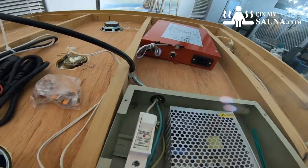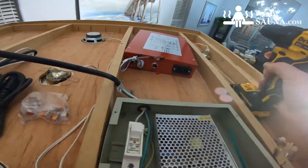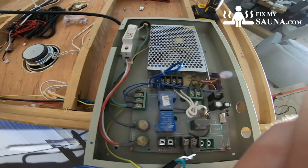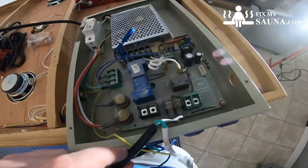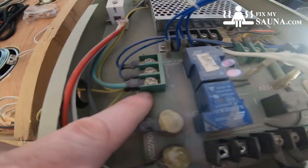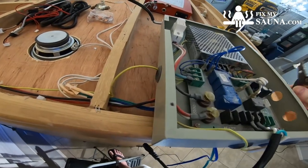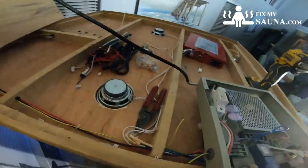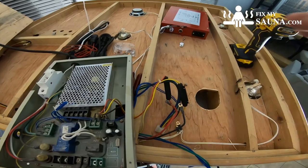Next, I'm going to get rid of this power cable and get rid of this power supply altogether. This is your typical power supply. And here's your ground, it looks like — so pay attention to that. On this particular power supply, the heaters don't have three cables, they only have two, and it looks like they grounded it to the main board. So I'll go ahead and cut that ground, then get rid of this power supply so we can start putting in our new one.